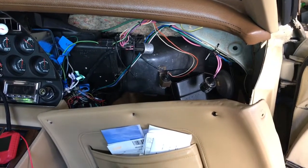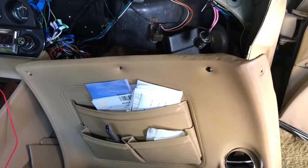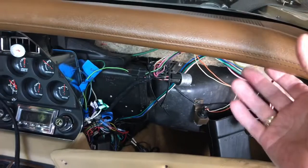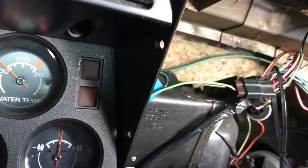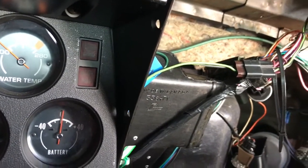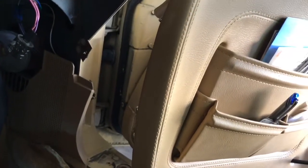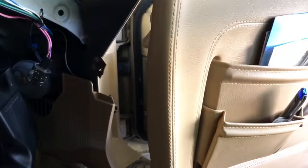The passenger side dash panel is off. A handful of things to mention: there are three screws across the top that drill up into the base of the dash pad, two screws on the side that go into clips through here, and on the center console there are two screw holes that go through the console into the side of the dash pad. Back when I put together this interior, I actually did not screw in the side of the console to the dash pad, so there are no holes over here.